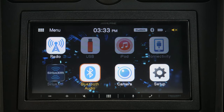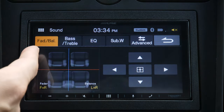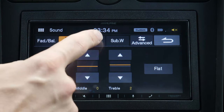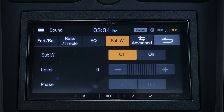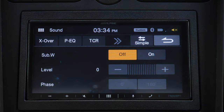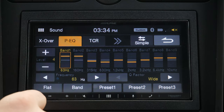Down below you'll see Bluetooth audio, which is pretty much standard nowadays — you can wirelessly connect your phone for not only music but phone calls using the included microphone. Within your settings you have the basic setup: your sound, fade and balance, bass and treble, and preset equalizers if you want to use those, along with your subwoofer control. If you go to advanced, you can control things such as your crossover, a full-band equalizer up to nine different bands, and TCR.